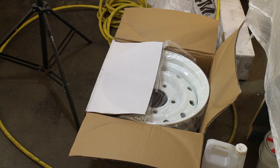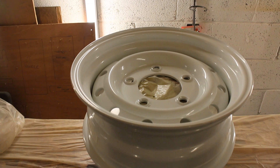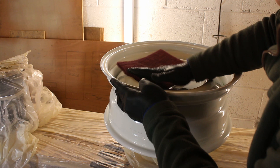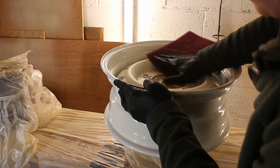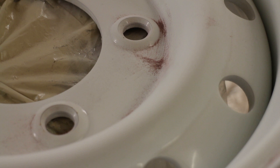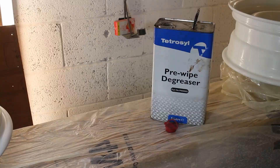Now for a blast from the past — we're going to paint the wheels. I used to work at a spray shop and painting is one of my favourite things. Everything is set up on a table on top of some paint cans so I can spin the wheels around. We're keying up the surface, abrading it with a red scotch-brite pad, which is roughly equivalent to 320–400 grit — just about perfect for solid paint colours. I'm taking off that shine because anywhere shiny means the paint is very likely not to stick. Hit every surface with the scotch-brite pad; when done there'll be a lot of dust. Blow away the dust with the air line, inspect it one last time, then hit it with some pre-wipe degreaser and a tack cloth.